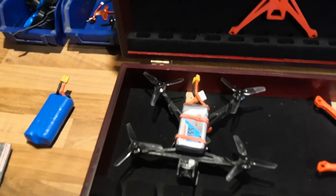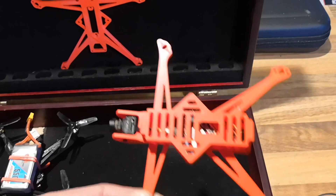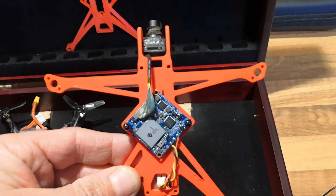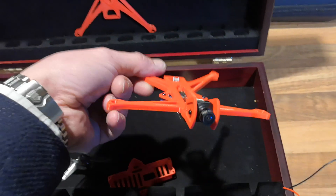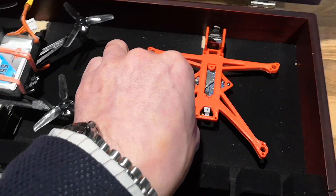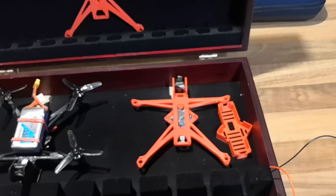I did want to stay true to the original as much as possible, so I am rebuilding — I've ordered a true 3D printed frame again with a true base to fit the specification that Dave C originally put together. But I was planning one change: mounting a RunCam 4K Split on there. One of my subscribers pointed out that nano long-range is fairly pointless without a decent camera, and I tend to agree — if you want to do long-range flying you want HD footage, because generally you're flying somewhere far away or somewhere scenic that you can't get to on foot.